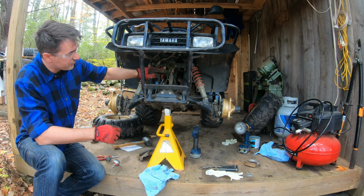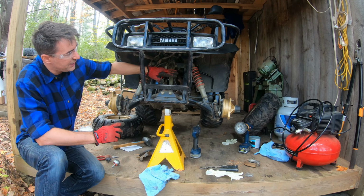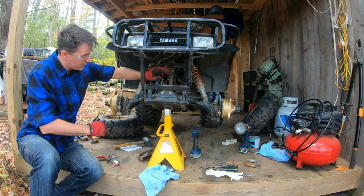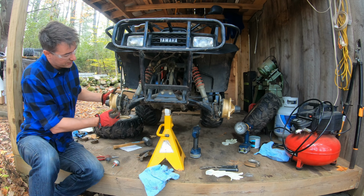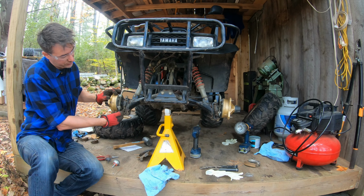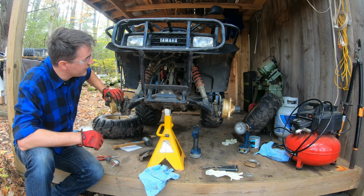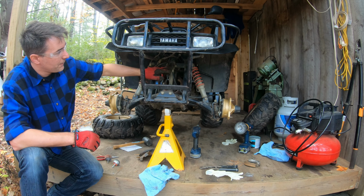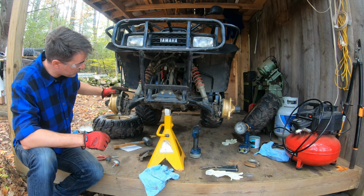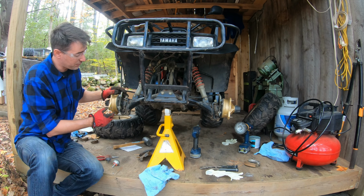The order of operations is get it so everything is pulling evenly, and once I have the cables lifting evenly, then I adjust so that they're both grabbing at the same point, which is to say, tighten it till it drags, and then I came off one full turn, so each one's a half, so one, two. And that's just how I've done it, focusing on getting an even pull on the cable. I suppose I could go at adjusting these for neutral first, and it should have the same effect.